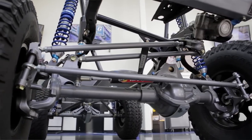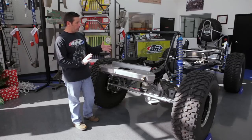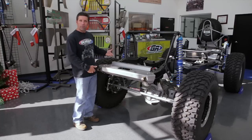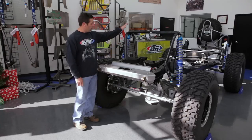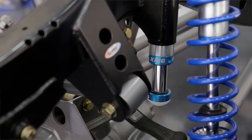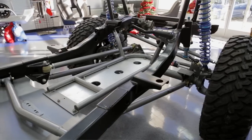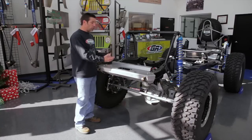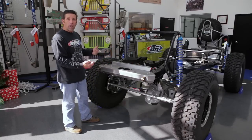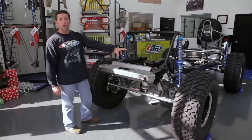This allows you to move the front end forward. You cut off the stock spring buckets, or if you're converting from leaf springs all that stuff goes away. You put on our shock hoops, install the shocks — we do air bumps or urethane bumps — and all the bump pads are built right into the control arm mounts. We also give you the ability, if you want to run our twisted pitman arm, to move the front axle forward up to four inches, which is really good without having to move the steering box.